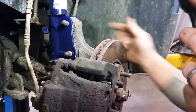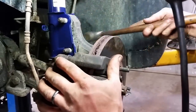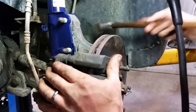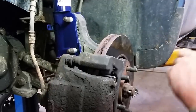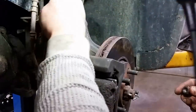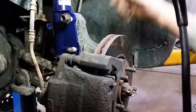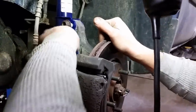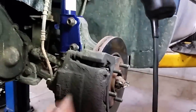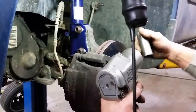Our next step is to put these bolts back in just like we took them out. We're going to knock them back through. Go ahead and put the nuts on them. Before you tighten it down, just try to center that bolt up in that lower hole there. Go ahead and use your 21 millimeter socket and tighten them back.